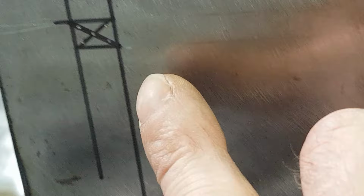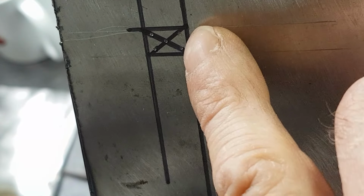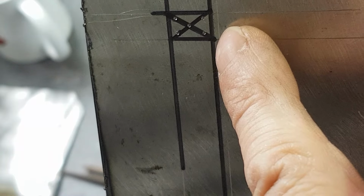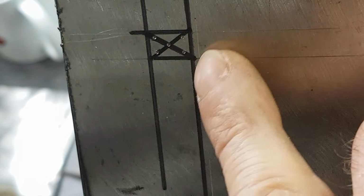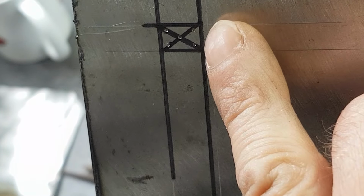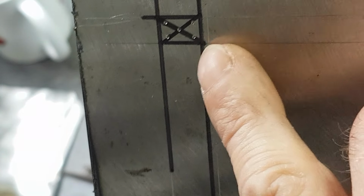See that? We'll just dot punch them now. Dot punch the centre one, and one's round the outside. At the minute, I don't have to be spot on, but you don't really want to get them ones right on the corner. If you just do them in, I'll show you why I've done that. You can put them on the corner, but then you've got to get them 100%. But we've got a bit of leeway here to play with then.